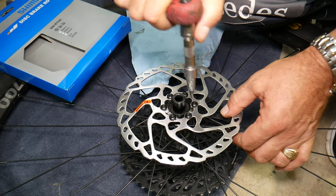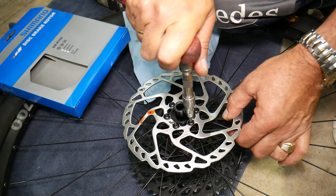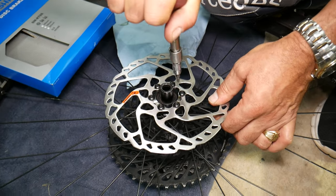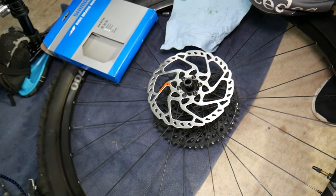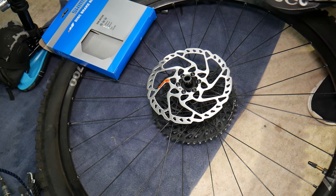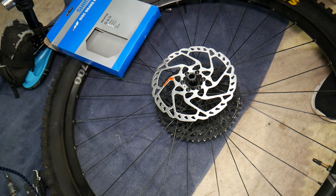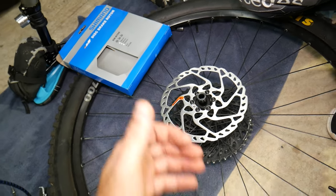That's it — we're going to recheck everything and then we're ready to continue with the next step, which is installing the wheel. I recommend putting in new parts and you're ready to go. It's not very complicated. I recommend riding a little bit to seat the parts, then check the torque on the bolts again to make sure they don't get loose — sometimes when things seat, bolts may loosen slightly. Recheck after a short ride to make sure everything's good. Hopefully this video is helpful — thank you for watching, see you next time.